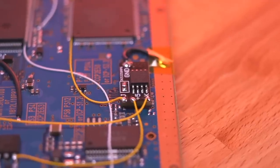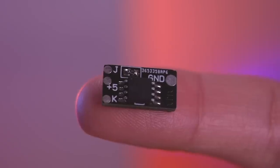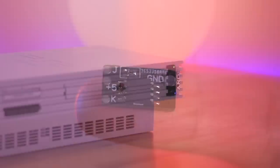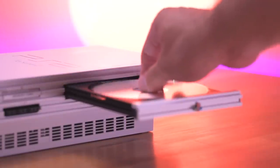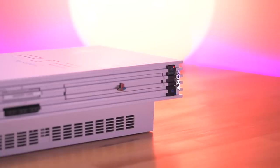And that's where the PicFix comes in. Originally designed for V12 models, it was discovered that the same mod works on V9 revisions as well. The V9 requires a 2200 ohm resistor on the PicFix board, instead of the 1500 ohm used for V10 and V12 models. What this mod does is detect if the Mechacon crashes and force the console into standby mode, to prevent any damage to the laser — a simple, elegant, and inexpensive solution.